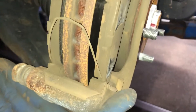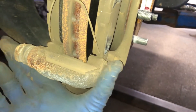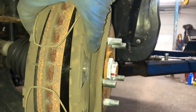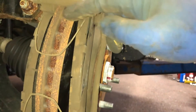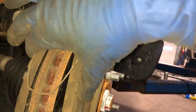You see this pin — notice how it pushes out. This needs to be lubricated more to work better. As your caliper squeezes and you let go of the brakes, it will slightly let go. This mechanism works with about 0.01 of an inch of clearance — that's all it needs. This pressurizes and opens the slider pin, as well as these retainers here. That's how the mechanism works.